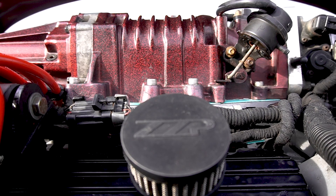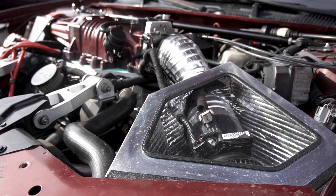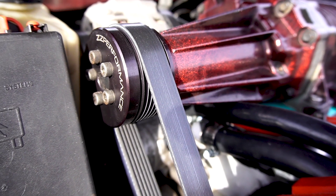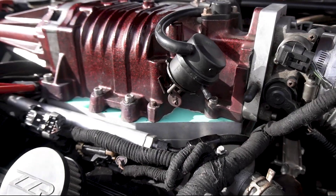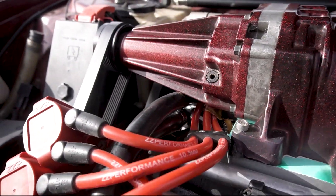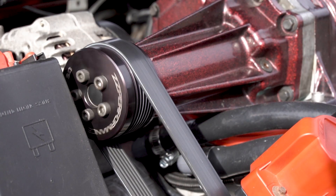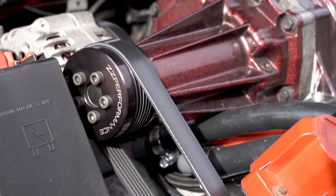For GTP guys, it's easy because you already have a blower. You can drop pulley sizes, do your down pipes, thermostat, PCM tunes, and make the setup more efficient so the boost drops — then put a smaller pulley on and the boost shoots back up. Make sure you're always within that range. With an intercooler, you can usually run in the 10 to 11 pound range, maybe a little higher, as the blower and the whole setup becomes more efficient.